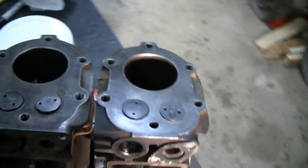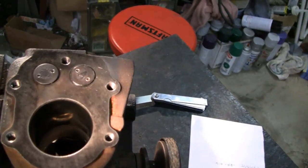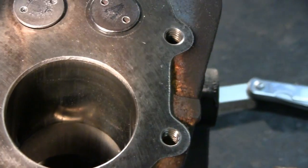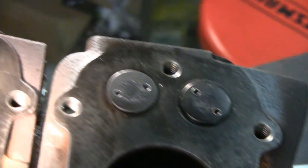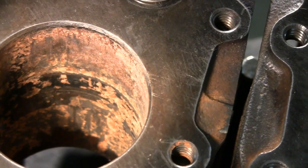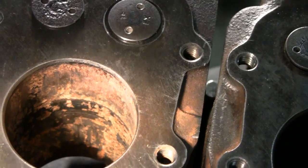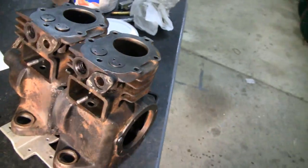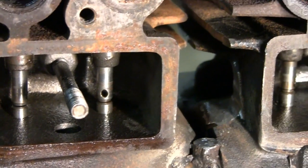The intake should be eight thousandths, so I'm gonna have to grind the valves to get them back into spec, then I can lap them. As for the cylinders themselves — this one here is in really good shape, incredible, nice and polished. The other one is gonna need some honing though. So I'm gonna hone them, lap the valves, grind and adjust them, and get back to you.